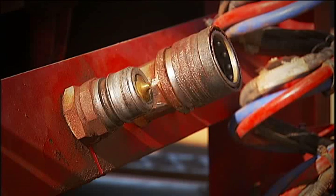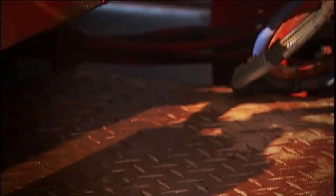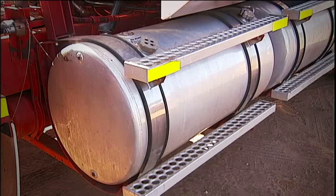At the truck end, Airtip does away with the need for hydraulic pumps, tanks and lines, eliminating any chance of hydrocarbon spills and the downtime associated with clean-ups. Airtip eliminates the need for a specific tank for hydraulics.